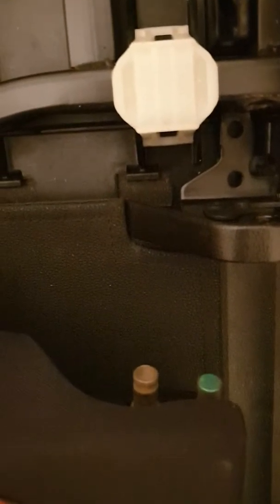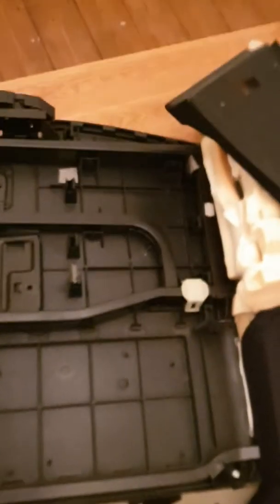I guarantee if you unscrewed it you probably wouldn't need to break it. This screw goes through there and into there — and actually the armrest comes out! There's no screw on the other side, it's just two pins — one at the top and another through the bottom. So this whole armrest comes out, and then this piece just lifts up completely and slides through the hole. This whole piece actually comes out nice and easily once you know how.